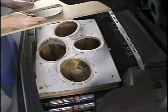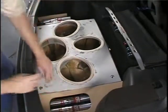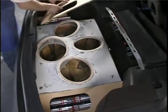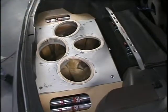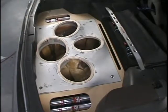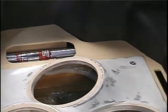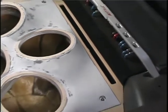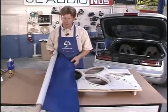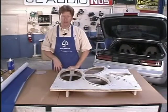We want to make sure the side pieces are going in level. Everything is fitting nicely. Now it's time to wrap in some vinyl. I've got our new carbon fiber vinyl - blue. We're going to do blue on the center and black on the trim. It'll highlight that blue suede - we could even do blue neon later on. A couple things you want to make sure you do before wrapping with vinyl: number one, scuff it with 80 grit. Number two, take some acetone or a prep cleaner and wipe the entire piece down, because even your own sweat will inhibit the adhesive from sticking. Make sure you get in all the crevices.